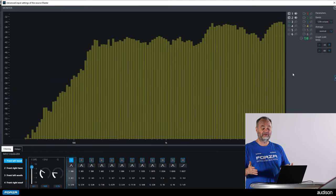I'm lowering the noise floor a little, stretching the display up, and playing each speaker one at a time to confirm I have sound and that left speakers are on the left and right speakers are on the right — because if any are connected backwards, it will make it very difficult to get the sound I'm looking for. You'll notice we only have 7 channels in our system even though this is an 8-channel amplifier. We are wiring the system to power a subwoofer with channels 7 and 8 bridged together, and we have already done that in the wiring, but not yet in the signal routing.